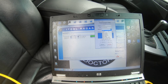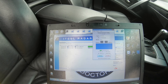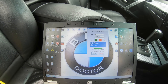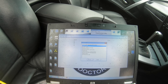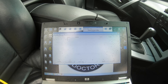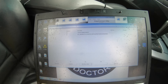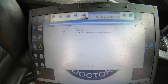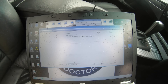Enter the IP address as 169.254.92.38, then click Base, go down to ICOM Lock and click it - it will connect to its IP address via the LAN. As you can see, ICOM is now locked. Now if we go to NCS Expert and just click Load Profile Default - this is just a test - we'll click E60, go to CAS, and as you'll see it reads out everything properly. That's how you use it. If you want to use WinKFP, NCS Expert, or any of those tools, you can also use i-Tool Radar to lock the ICOM, but I prefer to use Easy Connect - it's the one I always recommend.